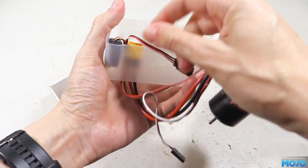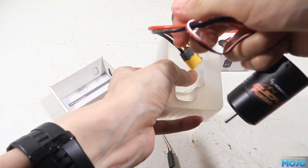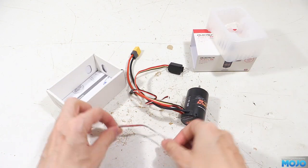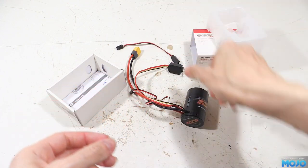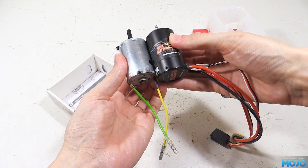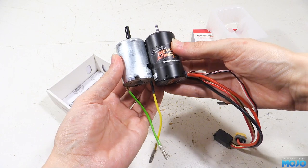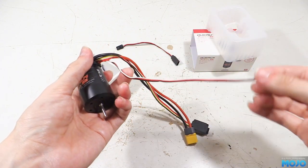Because the ESC is built into the motor, it makes a load of chassis space available for other bits and bobs. The only thing to watch out for is that while it's supposed to be a 540 motor, it's actually quite a bit longer than your typical silver can, so you might need to do some rearranging of your shift and steering servos to make it fit. We covered a micro servo mod for the gearbox in the gearbox stage of the build, so check that out for more info.